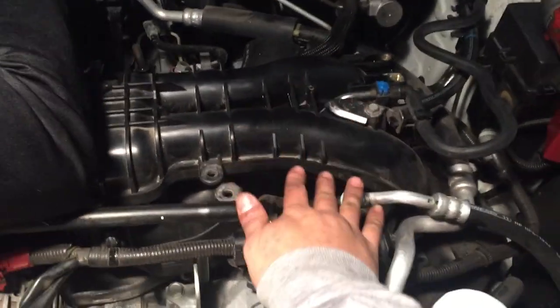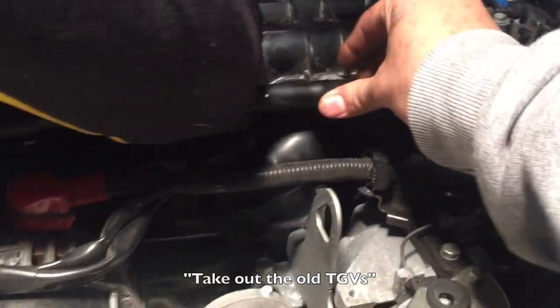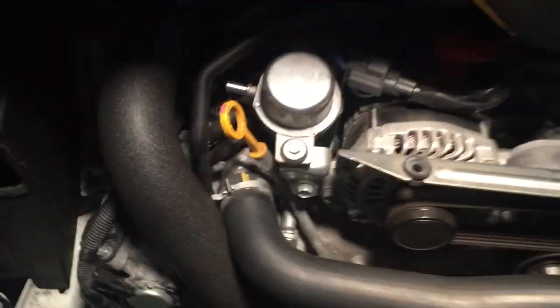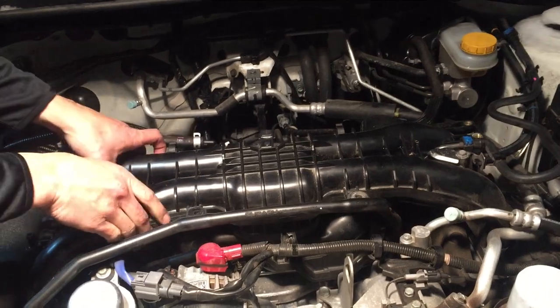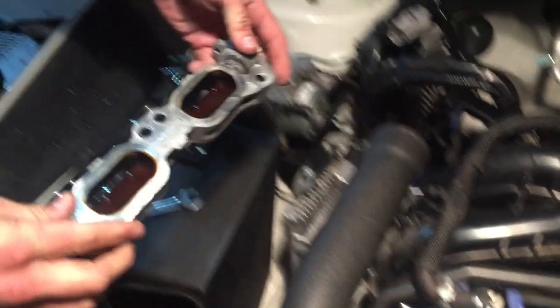So what are we doing? We're undoing all of the bolts holding the intake manifold in. Then the point is to lift it up and take out the old TGV. The method is to just slip them out. You took off the intercooler and aside from that you take the ratchet — careful. Those are the butterfly valves that basically restrict the airflow. We've got the new ones ready to go in.